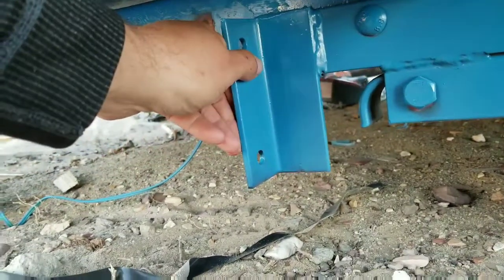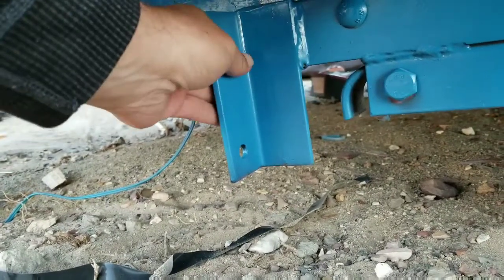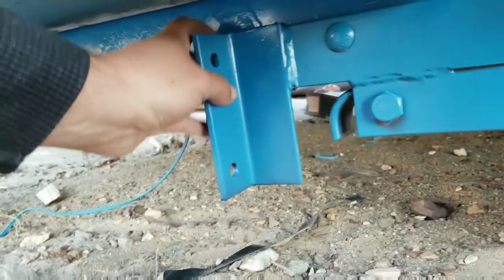This bracket used to be holding the feet for when this trailer was foldable, but that's all been welded and removed, so it's now a solid trailer. Inside the back of the trailer, looking at the very back, that's where our taillights are going to have to go. We haven't put any insulation on it at all because we're going to have to cut some squares in, pass some wires through, do some stuff like that. It won't pass inspection to give us a VIN number and a license plate if we just use those magnetic tow lights, so we can't do that. We actually have to bolt them to the frame somehow. So we're probably going to have to get a new light set, because I shattered ours when I flipped the trailer up with the tractor. Awesome.